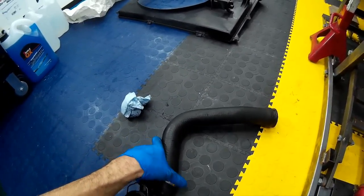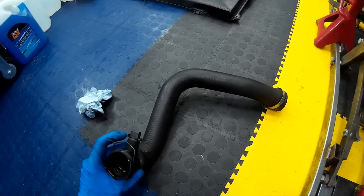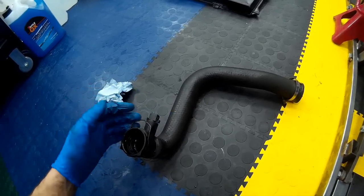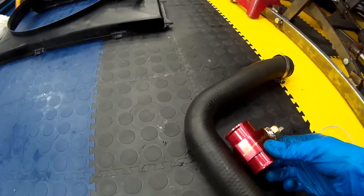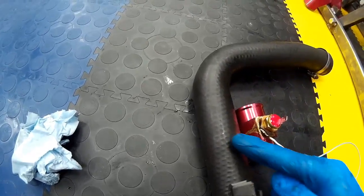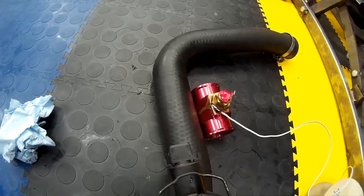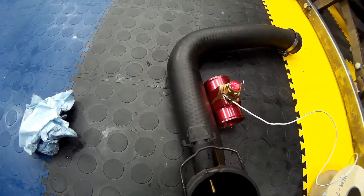E39s have been known to have poor cooling systems especially on the V8 flavours — the 535 and 540 with the M62 and M62 TU engine. The S62 in the M5, because it runs a lot cooler, generally doesn't suffer with heat issues as much. I'm going to offer up the bracket and the centre mounting unit to where I want to fit it — it'll fit just where I want — then I'll mark on here with a permanent marker where to cut, slide the hose onto the body of the sensor holder, and refit it back to the car with a jubilee clip on each side, making sure the orientation of the pipe is correct so it's not twisted or stretched.